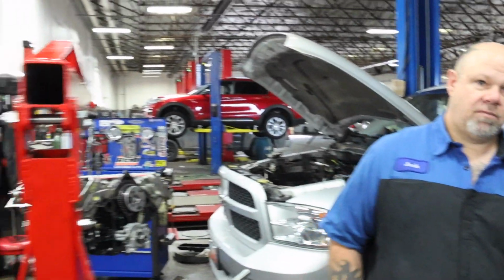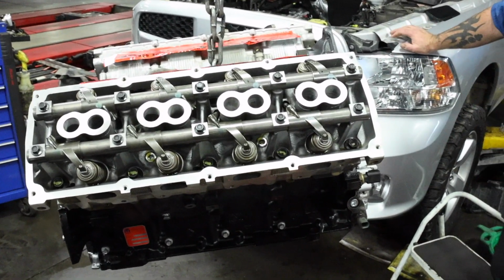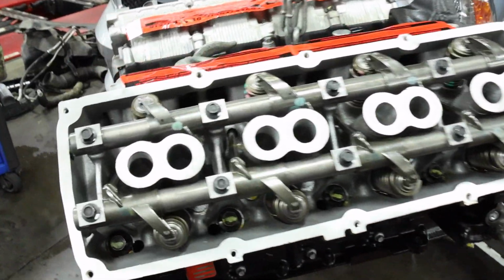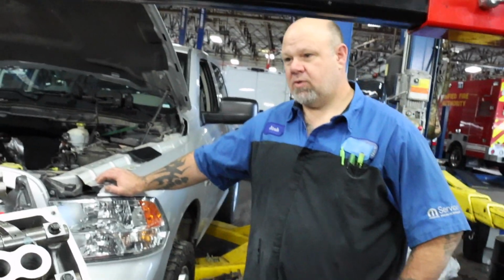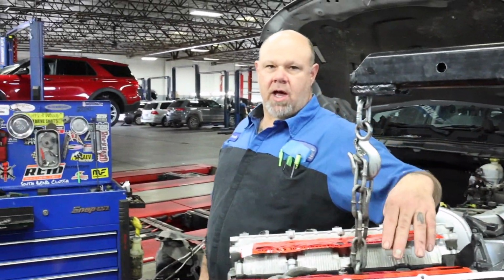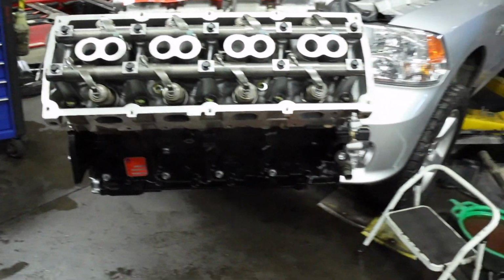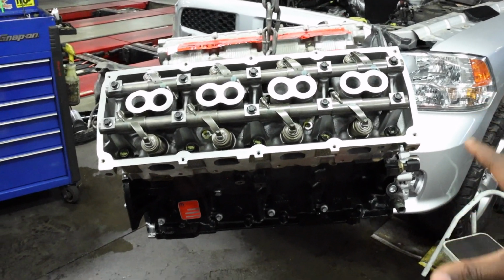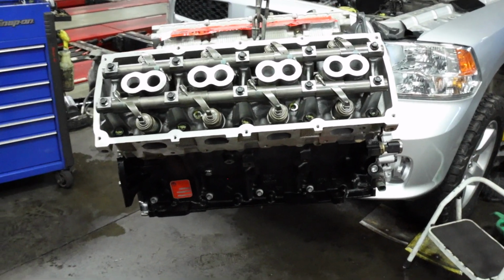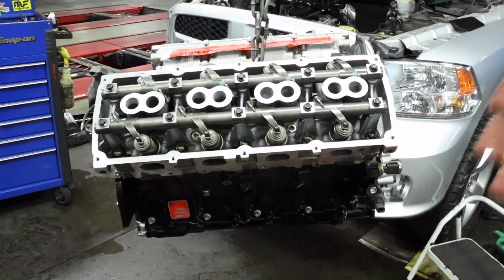Gotcha. What you guys are hearing is that these engines have gotten so advanced, and one thing I've noticed is that Stellantis, Ford, and GM pretty much stopped caring about the V8s. When was the last time you heard an update on the V8 for GM? When was the last time they did a major overhaul on the HEMI? It hasn't happened. 2009, when they got away from EGR and started going to MDS and VVT. They've let these engines go by the wayside because now you have the Hurricane, you have the EcoBoost. Everyone's going to a V6 or inline six-cylinder engine, and that's where all the R&D has gone. These engines probably could have been made reliable over time, but there was this push to put out big V8s for whatever reason, and this is why we're having these issues: they just haven't done enough research and development to make them more reliable.